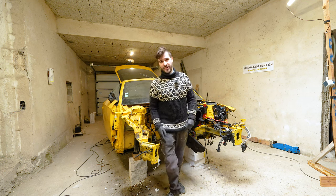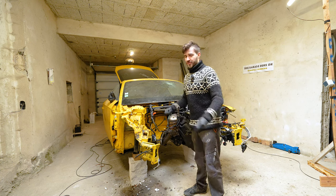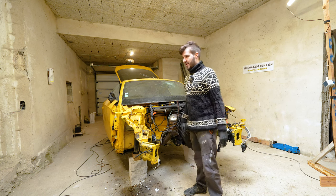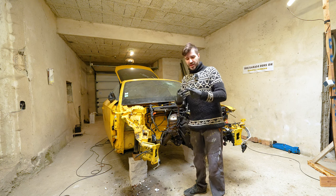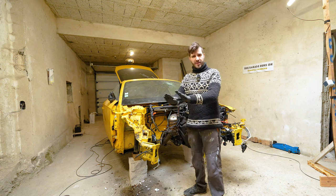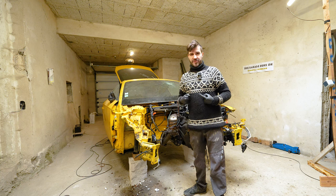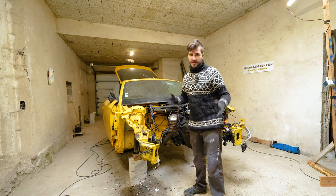Obviously, I have removed the subframe last night and I did it off camera, sorry, but it was just a matter of pulling everything out, the couple of screws that were already loose, and then just letting everything drop down. The only important thing is, I showed you in a previous episode, there is a small screw that is supposed to pinch the steering column to the steering rack, and it sits in the cabin behind where the brake pedal would be, and you need to remove that screw completely in order to drop the steering rack out of the car. Doesn't seem logical because it looks like a pinch bolt. It isn't, you have to remove it.